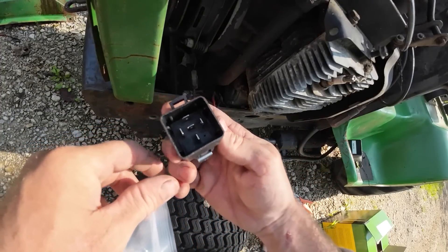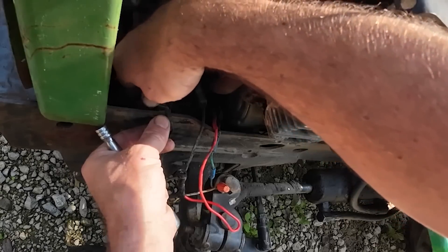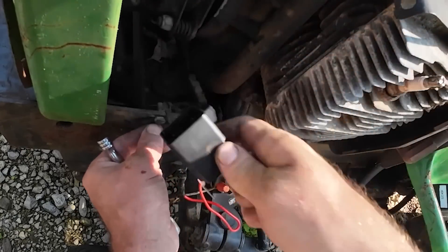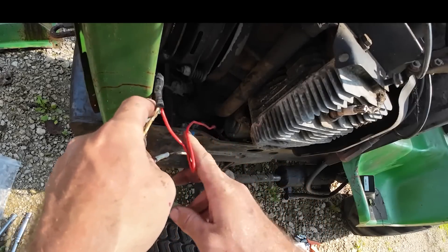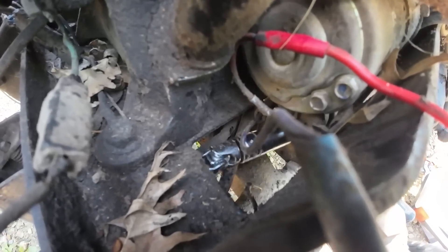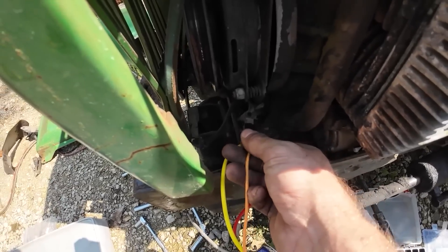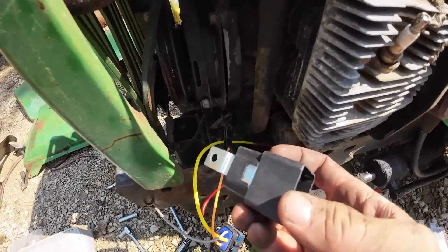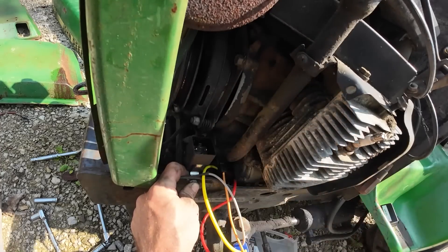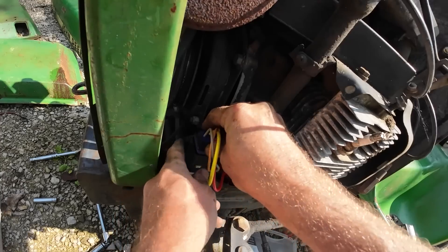There's the new relay. There's a broken clip coming off of here - I'm assuming that's probably where the relay bolted on. Trying to figure out what he's got going on - so that's two extensions with a wobble socket and a 14mm, seems to be the answer for that. The exciter wire had a different style connector on it so I did have to use the old connector, but it looks done - heat shrink looks nice and it clicked right in. Now we've just got the ground and the actual bracket for the relay.